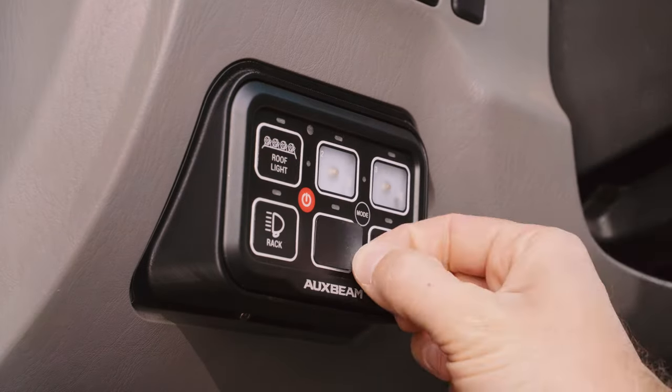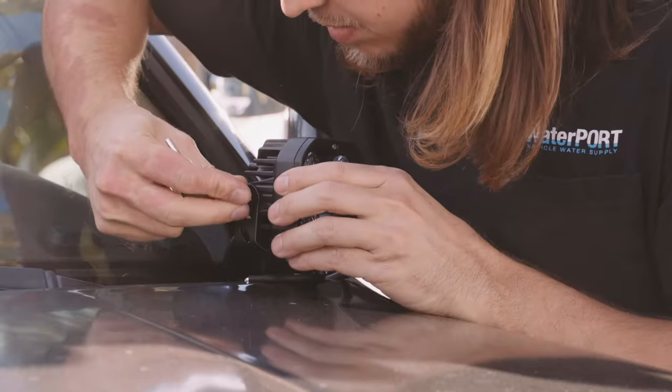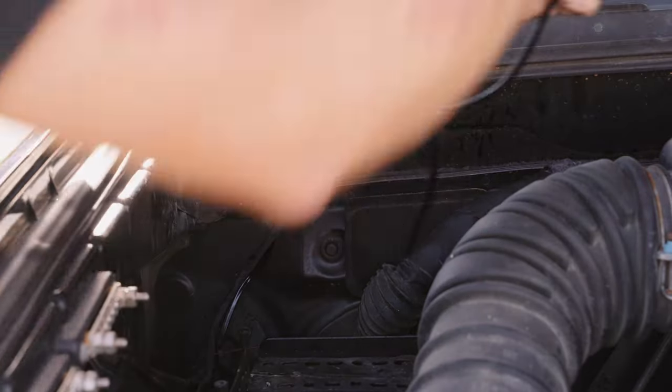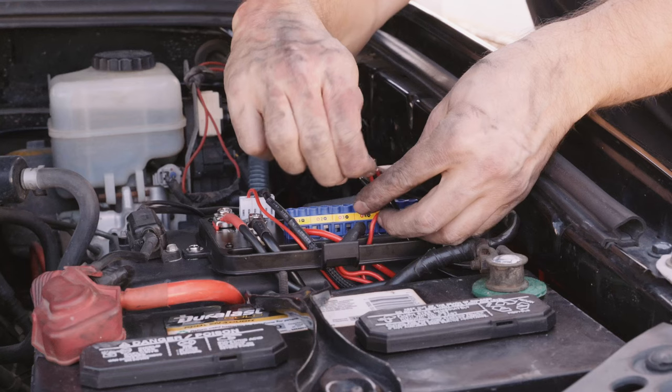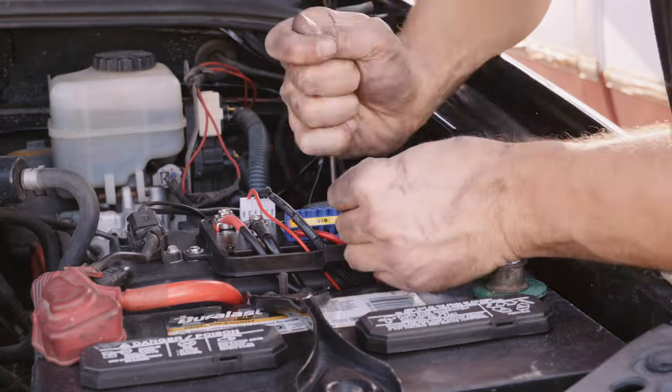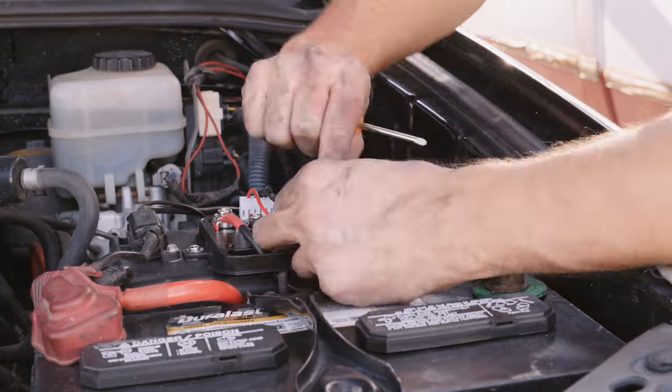Colite LED sent me these rad ditch lights, and I ran them both to the same terminal, and I just twisted the wires together. They came with decently insulated cables with positive and negative bound together, so I didn't tape these ones up, and I connected both positive and negative directly in the fuse box.